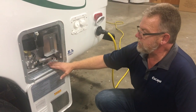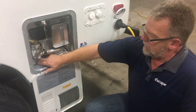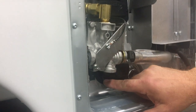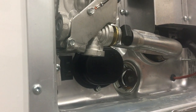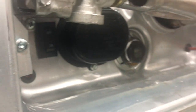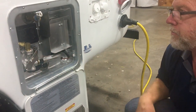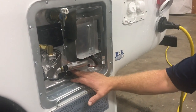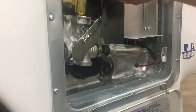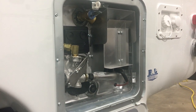Now what we're going to do is go outside and drain our hot water tank. For those of you that have dual hot water tanks — meaning 120V electric and gas — there's an electrical switch down here. That's one of the reasons the manufacturer builds it this way, so when you go to winterize you remember to shut that off. Off is in the up position. What happens is if you plug in your trailer and that's left on with the tank empty, the element inside for the electric side will burn out. So we want to make sure that is off. Now we're going to remove our anode rod — that is really the only way to drain a hot water tank. What I always do is pull my pressure relief valve first because there'll be pressure in there, and if you just take the rod out it will shoot out and hit you in the leg, which isn't nice.